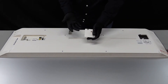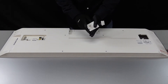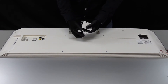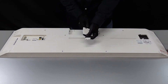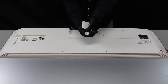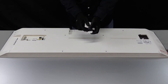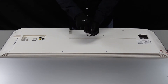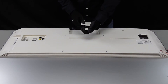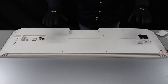We didn't show all of this because we removed this television from our teardown department and the cord's already been clipped off. But once you get this popped up, you'll have access to your power cable right here. There are two clips on the side — pinch in and walk it out. If you need, do one side at a time: press, shimmy that side out, then do the other side. Once this is out of the way, we can remove the screws and get the back off.